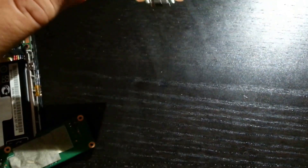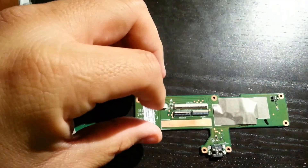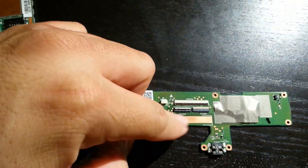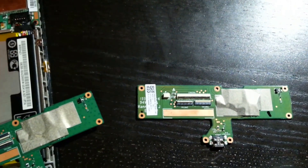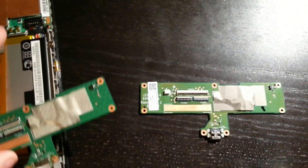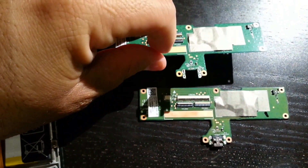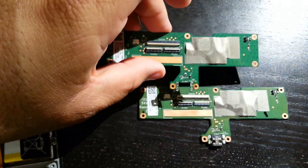What I did was figure that maybe the ribbon was messed up during reinstallation — there are two little ribbons that go here. I did it all over again, but it didn't fix the problem. So I put the original sub board back in, and lo and behold, the touch sensor did work.